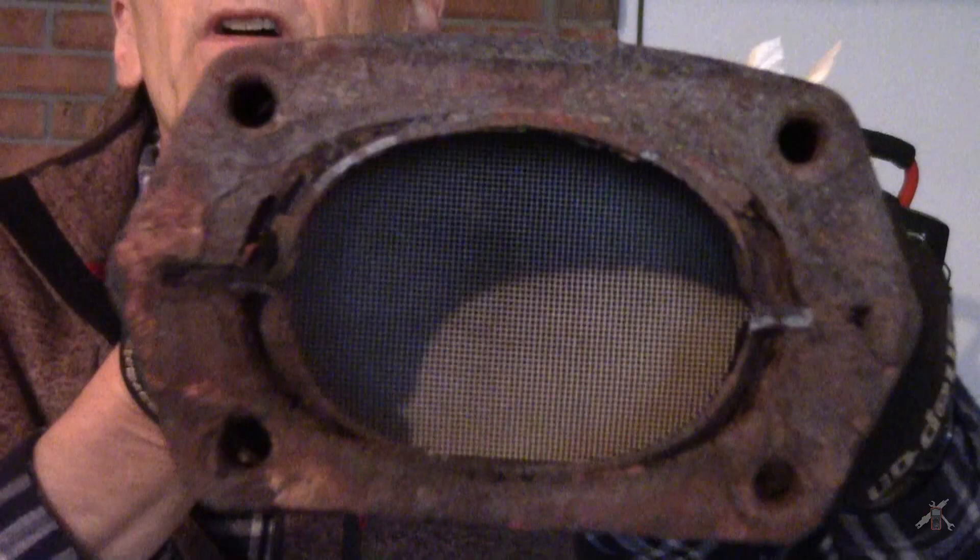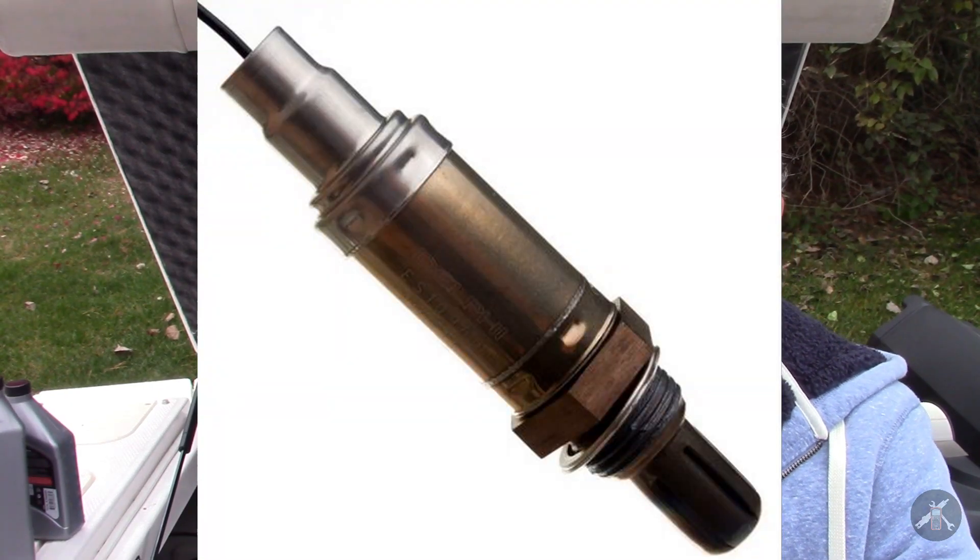Here's a picture of a catalyst out of my Camaro — you can see the honeycomb holes in the ceramic brick, which is a good example. And here's a picture of an oxygen sensor — you can see the element that is sensitive to impurities like silicone. It's also sensitive to liquid coming out of the cylinder: if you got a big slug of fogging oil and it hit that sensor, it could thermally shock it and cause it to crack, giving you a bad oxygen sensor. So take care with winterizing to protect your catalyst and oxygen sensor, make sure the cylinder walls are coated as Mercury recommends, and you won't have trouble running next season.